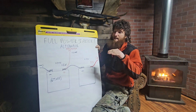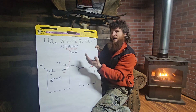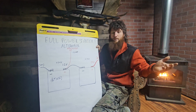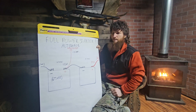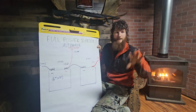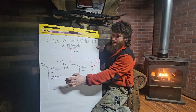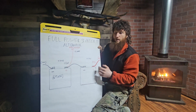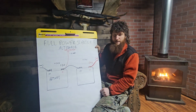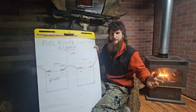I put a battery maintainer on mine — that might balance them out, and since I'm not usually running for very long I could probably get away with it for quite a while. This may have had something to do with the demise of these batteries, but they were 15 years old and getting weak to begin with. I had to leave the maintainer on all the time or they would die — they died at least twice in cold weather. Don't cook your batteries. I'll get you the national stock number for the 6TMFs. If you have the $1,400 to spend on those, by all means. I'll probably get about eight years out of the Interstates — a third the price to get half as long; I'll upgrade in seven or eight years.